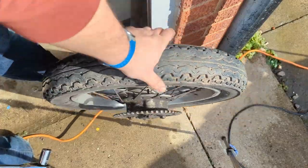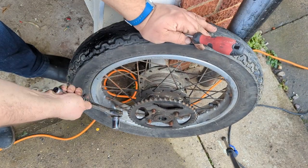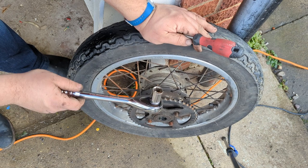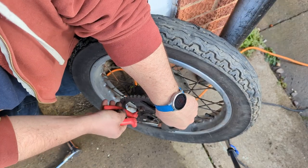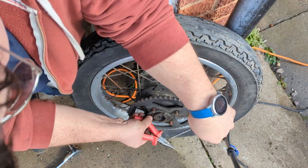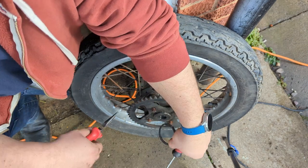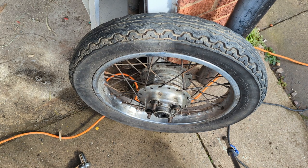Missed a tab I think. Looks like we've got a circlip too. Must be my lucky day - one utterly horrid old wheel all cleaned up. Sand sprocket done. I'm just going to make sure it's completely clean and then I think we'll cover it in ACF 50 and leave it there for the time being until I get some time to sit down with Autosol and polish the rim.